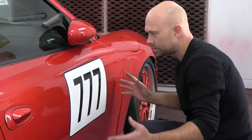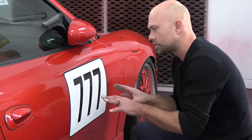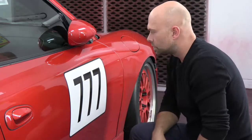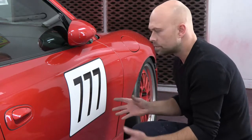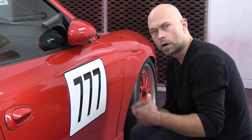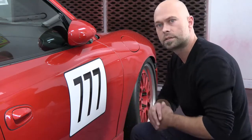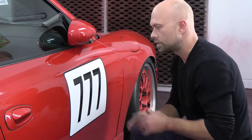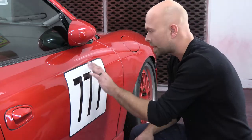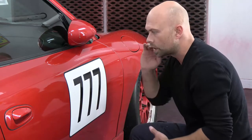We are done with this project. After two coats of 2k urethane clear coat and a quick bake, it looks great. We'll let it dry overnight and I'll come in tomorrow and hit these edges with a little 2500 to make that transition smoother. Quick recap: we started with autoborne sealer white for the first coat of white to cover the existing numbers — that's what we recommend as your ground coat. We always recommend starting with our autoborne sealers because of how they cover, how they sand, and how smooth a finish they have. In this case I did 400 DA and went back and red scotch-padded the edges where I couldn't get the DA in without going onto the existing finish.